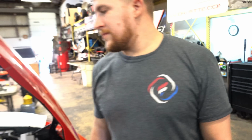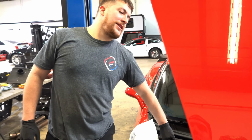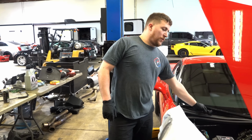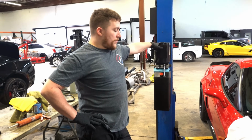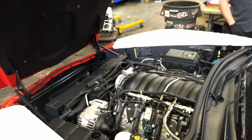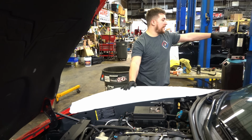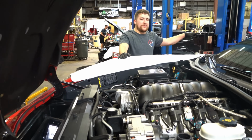This is just getting a cam package, right? Yes. Anything else? Pinning the crank because he's going to do an A&A kit down the line. So while we're having the balancer off, that's also getting ATI. We're going to pin the crank. Nice. That'll make your A&A install nice and easy when he finally decides to go for it. I hate pinning the crank.